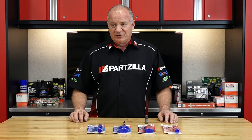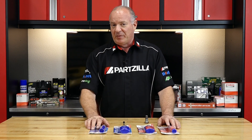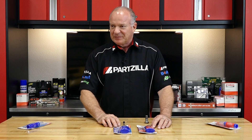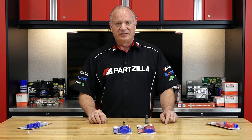But let's be honest, are you going to keep eight to ten different thread lockers in your toolbox? Probably not. My rule of thumb is I at least have a blue and a red on hand, because there is a lot of overlap — having just those two in your box will get you through and get the project done for the day.